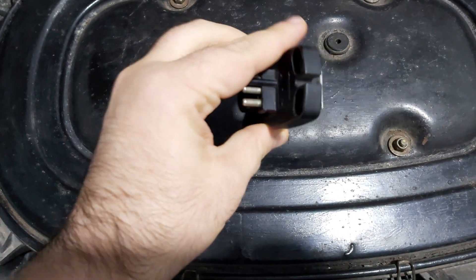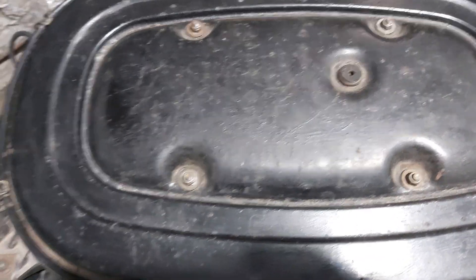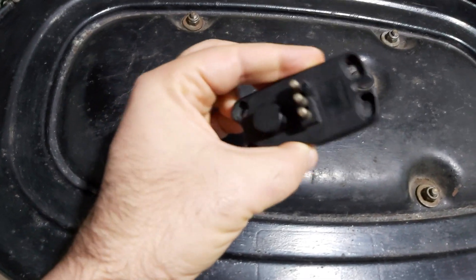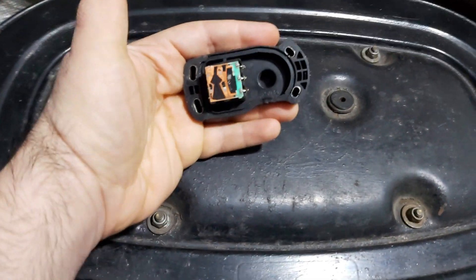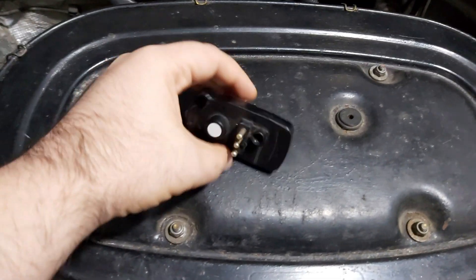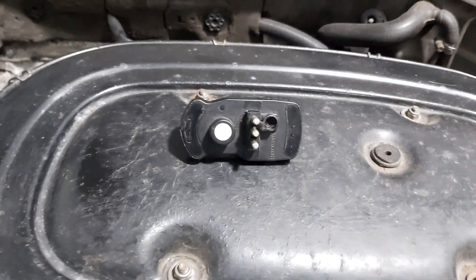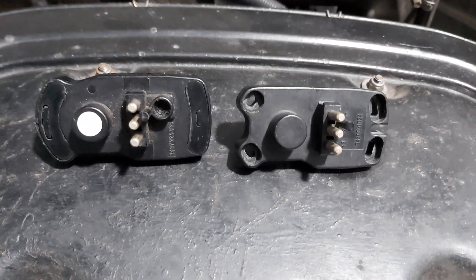Plus the potentiometer: on the TSZ you have one style, while on the EZL it looks different. The look is not so important, but what is important is that these TSZ potentiometers did not react as swiftly on the signal from the ECU. The EZL potentiometers are the only thing that controls the RPM at idle, and there is also a variable resistor which plays a significant role in the potentiometer signal — see the difference for yourself.